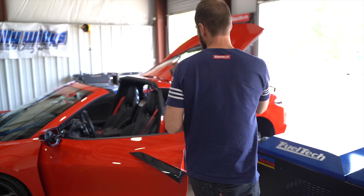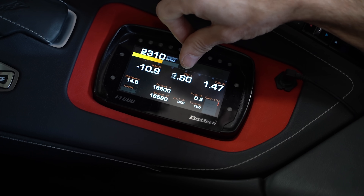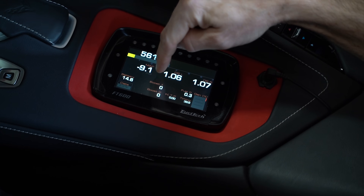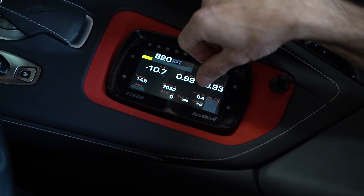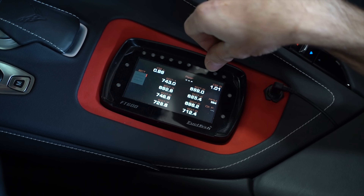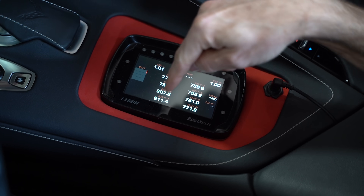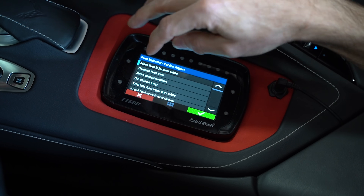This car obviously still runs on the stock computer on the main DI, so the FuelTech is working together with it. The FuelTech FT-600 is a standalone ECU, but in this case it's actually working together with the stock computer. So this is the ECU that is controlling the car. We can see engine RPM, MAP, and air-fuel ratio. We have dual O2 sensors in addition to the OEM, so the FuelTech is seeing both air-fuel readings by itself. We also have battery voltage, boost 1 and boost 2 which show turbo speed for each turbo individually. This is the port fuel injection pressure, and here's the boost controller. We have EGTs so we can know exactly how each cylinder is doing — each cylinder temperature. You can change the map and have different settings; we can fully control everything from the screen.